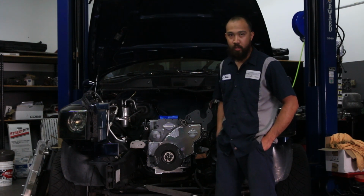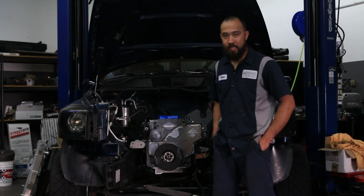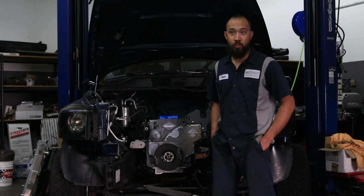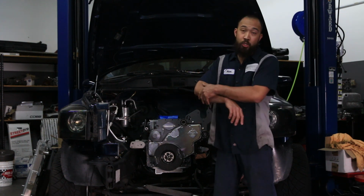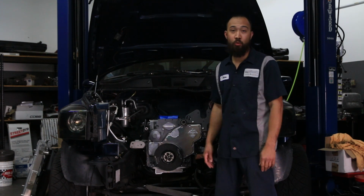in Bakersfield, Truck Wars, and went out there on a fresh transmission, and first pass I left a little hard, didn't really realize how sticky the track was. It was prepped really well. I guess there were some pro guys running the day before, so it was sticky out to 330 at least. I heard a sprag after tearing down that transmission. It cracked the sprag, the plastic portion of it, so it's a roller clutch. And then the truck wouldn't do anything after that.